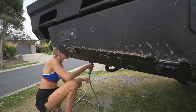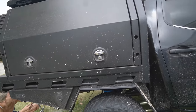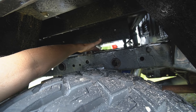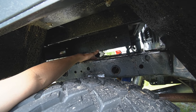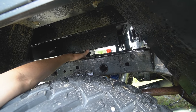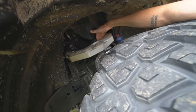After spending considerable time on the chassis and getting the bulk of the sand out, just run under there and get all the visible sand off. Next time you wash the car, do a quick 30 seconds of water down the chassis rail and you'll find more sand comes out. Another sneaky spot on Nissans is the top of the strut tower — it just fills up with sand, so get your hose in there and blast it out. It's worse with coilovers since there's no way for the sand to escape.